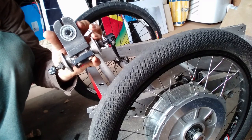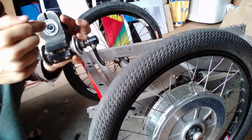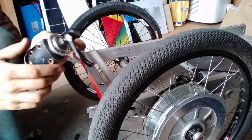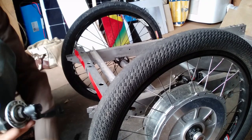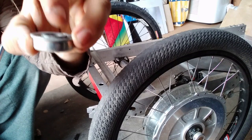It's one inch and it's got a little lip on it. This is a BMX stem made for a one-inch steer tube, and this is probably for a BMX 22.2 handlebar clamp. You just have to find a front hub that fits inside the stem that you made. Here's the bearing — you can see it's got a little lip on the top.